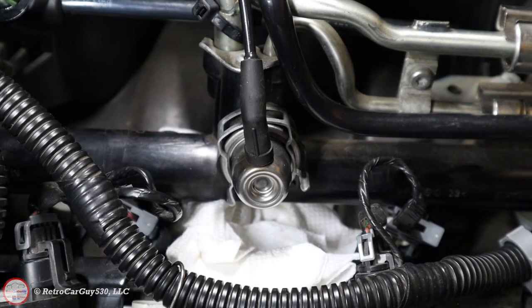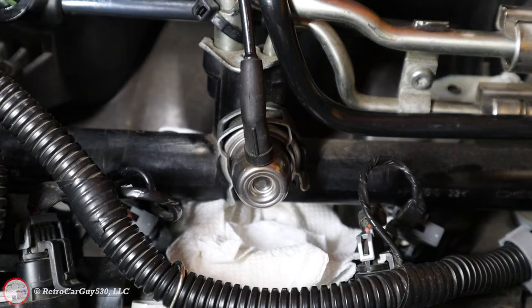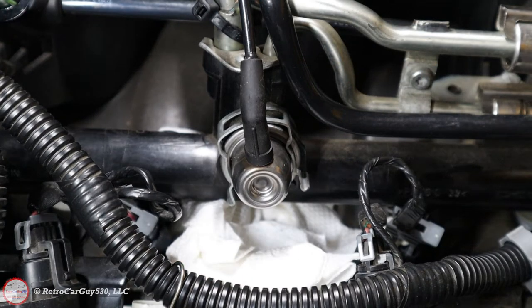I'm going to be replacing the fuel pressure regulator, which is right here on the fuel rail of this 2004 Chevrolet SSR. It has a 5.3 liter LM4 V8 and a return style fuel system. There are two lines here — one bringing fuel in and one for the return side. The fuel pressure regulator sits between those two and adjusts fuel pressure based on the amount of vacuum present in the intake manifold. This connection goes up to the intake manifold just off camera, and at idle the vacuum is at its highest point.